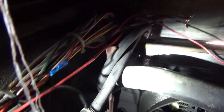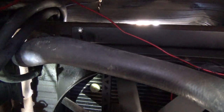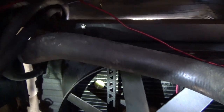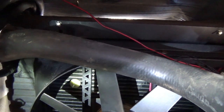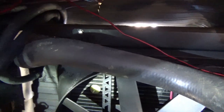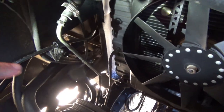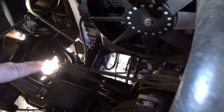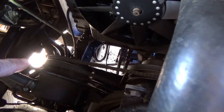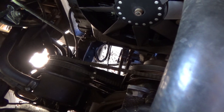You can see back behind the fan that white disc — that's one of the retainers that holds the cooler in place. There are four of them on the front and they all came with the kit. These lines then go down to the bottom of the front of the oil pan, run across to the passenger side, and hook up to the transmission in the back.